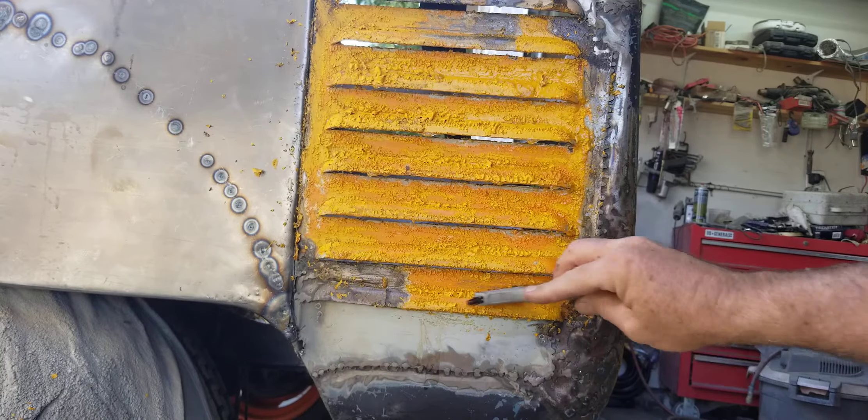It's a patient game. Notice now, even after I put that second coat on, it's really starting to react quickly and the stripper is very wet. With the drill I've got to be careful because it's going to fling a bit. I have shorts on and no gloves and I haven't got anything on my hands — but that's just because I've done this a lot. I'm saying you should definitely cover yourself up your first few times.